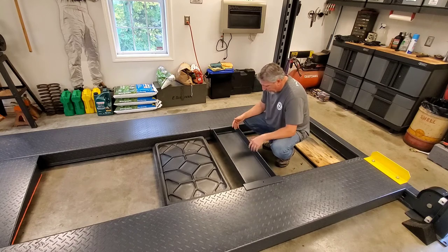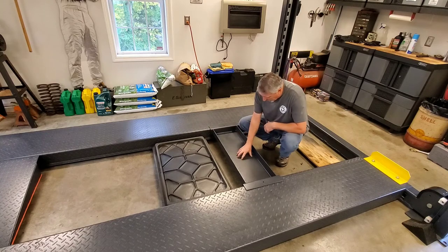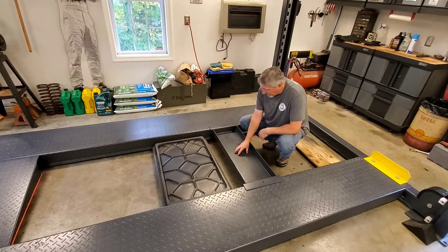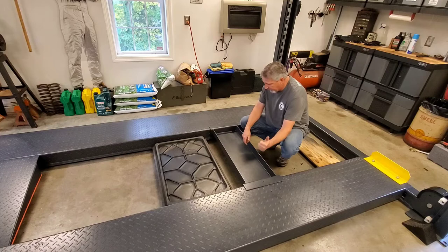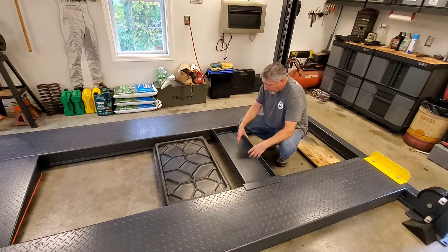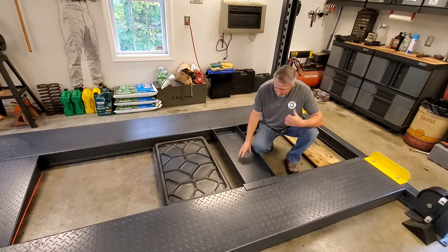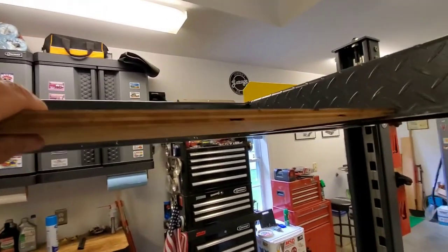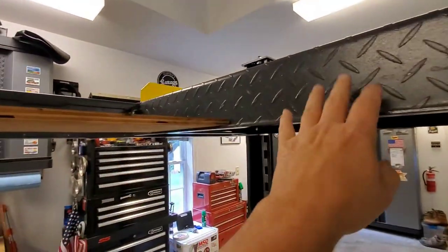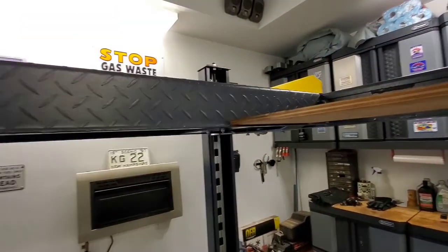It's sliding back and forth. When I want to jack up a car on the lift, I can put a bottle jack in here — sometimes even a small floor jack, but that only allows me to lift up one side. A bottle jack is perfect. I keep some steel plates, some old 2x6s, 2x4s — just get creative. I have this piece of plywood cut to fit between the two rails, and that allows me to put my drain bucket here when I'm doing an oil change.